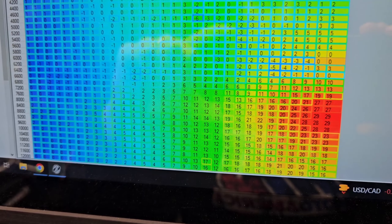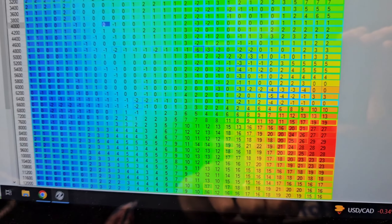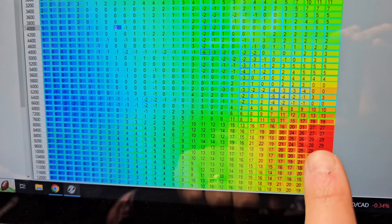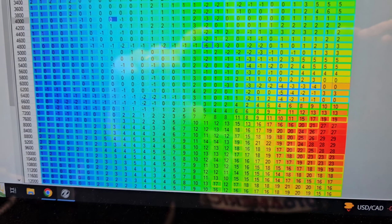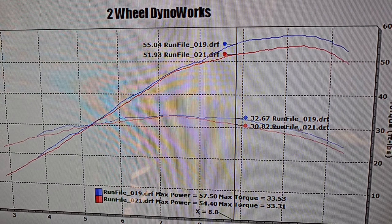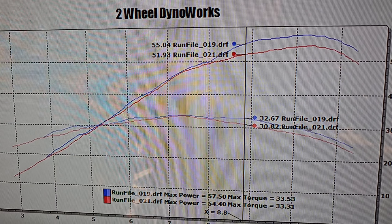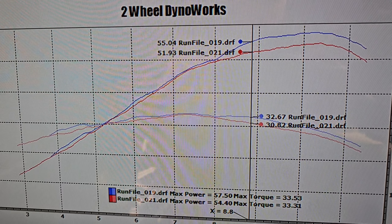On the delta table, the left-hand side is RPM and the x-axis is throttle percentage. Way out at wide open throttle, you're looking at 29 percent more fuel at 8,800 RPMs for the full Spark system versus the M4 with the baffle in. On the comparison graph, the blue line is the full M4 with the baffle in and TST stacks, and the red is the same setup but with the Spark exhaust installed. That's 29 percent more fuel for about three horsepower less.